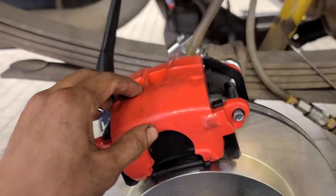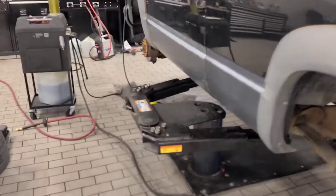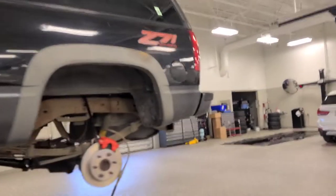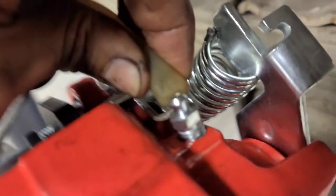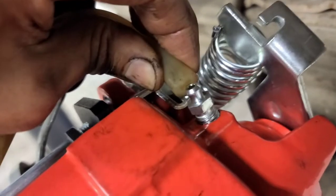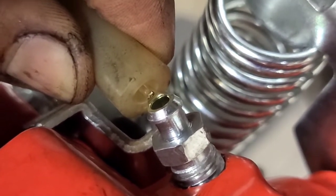It's a little tedious but we got no touching, no rub marks, and I just bled this side. I'm gonna do the other side. I had brake fluid everywhere because the thing kind of exploded. Hopefully this thing can drive on the first go around. I'm about to show you a secret I just learned. This one's done - you can hear it, you can see how we get a constant stream coming out. I'm using a vacuum on the line. Solid, that one's good - on to the next one.